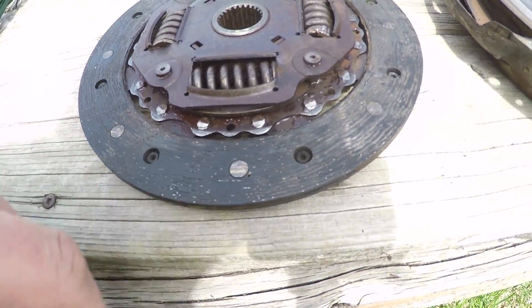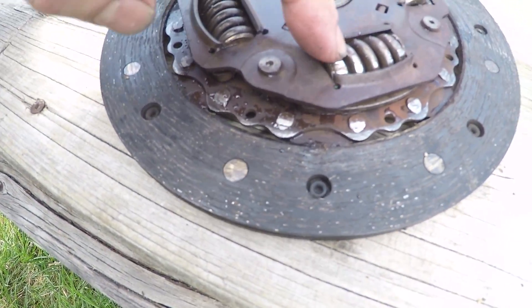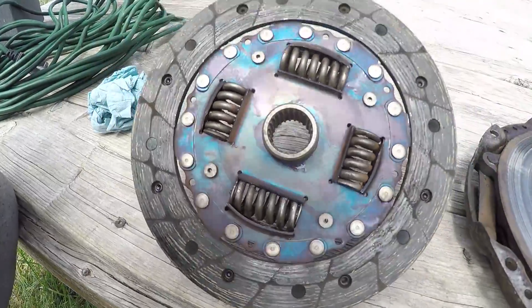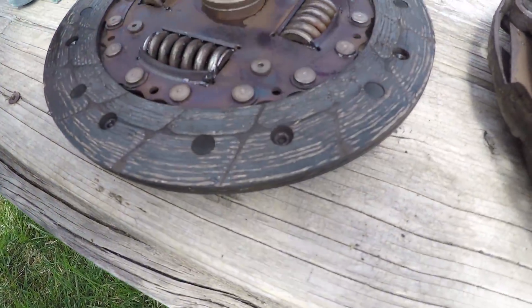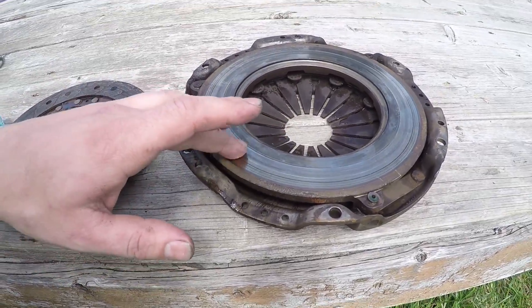The clutch is quite chewed — it is missing some parts, the springs are beaten like crazy. It's starting to peel off and is slightly eaten, so we're definitely getting a new one. The next step will be to take the transmission inside, disassemble the diff, and slide the LSD into the diff. I think we're going to have to do some machining because I don't think the LSD fits — we may have to grind part of the diff gears. Lots of work to be done. I hope we can get the transmission done this week and get it on the track next Saturday.